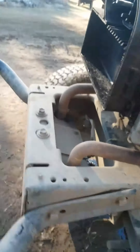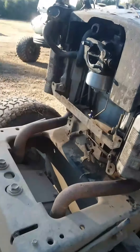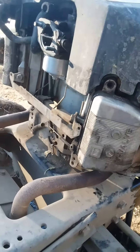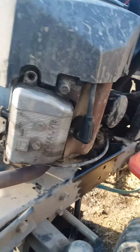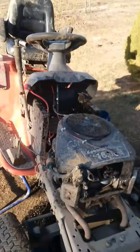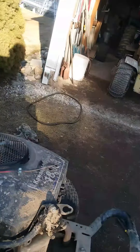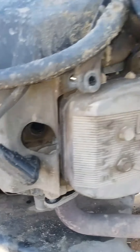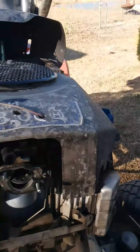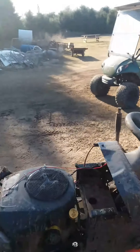But I think it'll run. I pulled the float bowl off the carburetor and there wasn't any water in it — surprisingly, I don't know how that happened. I'm pretty sure it didn't suck in any water, because as soon as it hit the water I think it grounded out the spark plugs on either side before it could get any water in the air cleaner, and it killed it before it could suck any in. I think I got lucky with that.